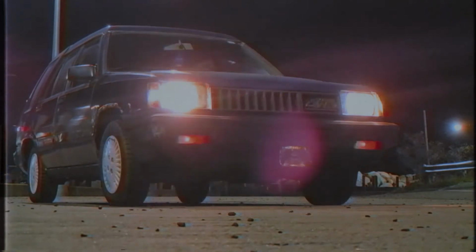The next problem to overcome is the oil pan. If I try using the factory 4A-FE oil pan, it will not clear the cross member or the front differential. Thankfully, with some slight modifications, I can make the 3AC oil pan fit. What I'll need to do is graft the top of the 4A-FE pan to the 3AC pan.